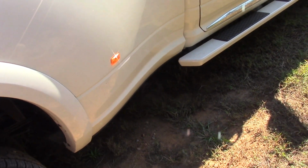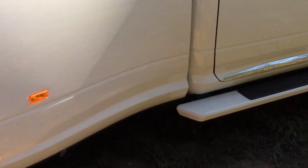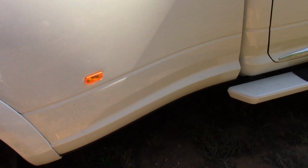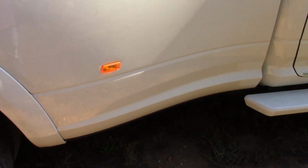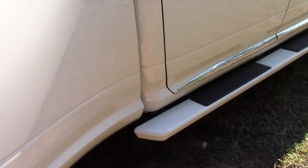And this setup, this is an Aisin transmission. The Aisin transmission with that parking brake, especially going up this hill, basically allows you to, when I get up to the top of the hill, if I'm in low range, I can easily switch into high and take off without any worries about the truck rolling backwards. It basically locks up the transmission, and you can make a really smooth start in high range two-wheel drive at the top of the hill and get the trailer up.